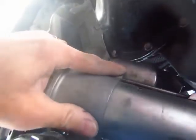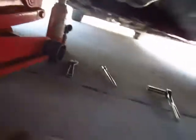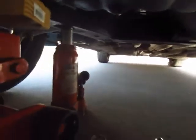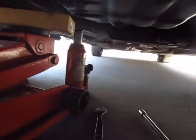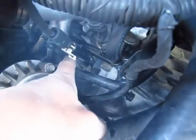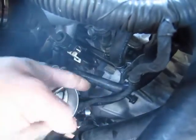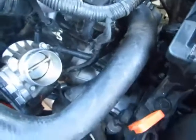The reverse is when I put the new one in — I'll go ahead and tilt it like this up in place, and then once it goes up like that I'll be able to sit it in there. I got a jack and a small bottle jack kind of for extra instead of a jack stand, and then I have the back wheel blocked and the parking brake on. When it's out, you put it in place and then tilt the bottom where the wires are down and bring it out from the transmission, and you'll be able to pull it down.